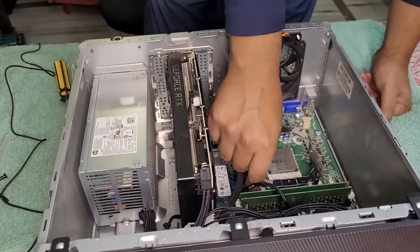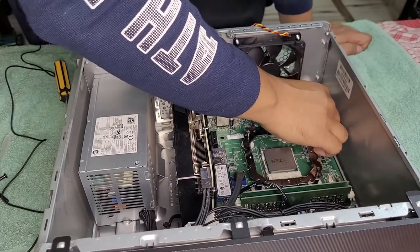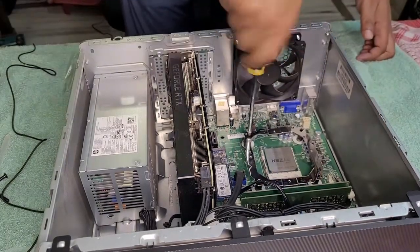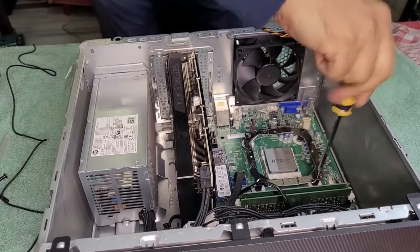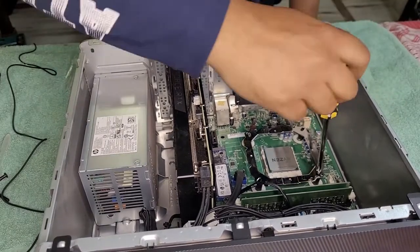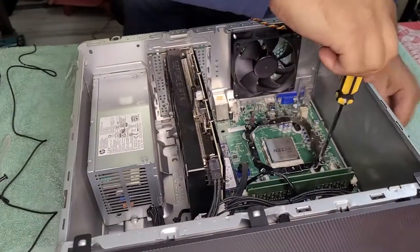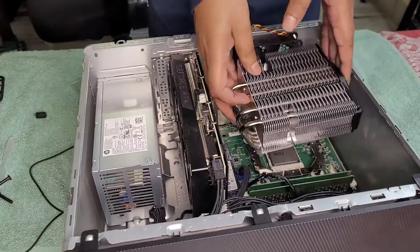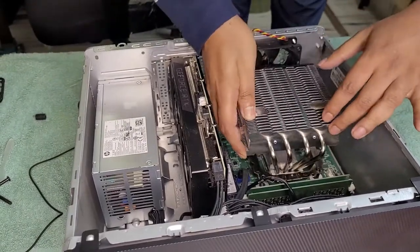The motherboard is an HP custom board, which means it's really difficult for aftermarket upgrade work. The motherboard does not come with conventional CPU cooling mounting holes — it has pre-fabricated screw threads, which means you have to mount exactly the same size screws, or else you are stuck. Luckily I had some matching screws lying around, so I was able to mount the bracket that came with the CPU cooler, but I absolutely couldn't use the screws and other mounting hardware that came with the cooler. So be very careful when buying aftermarket coolers — it may not be possible to mount them properly.